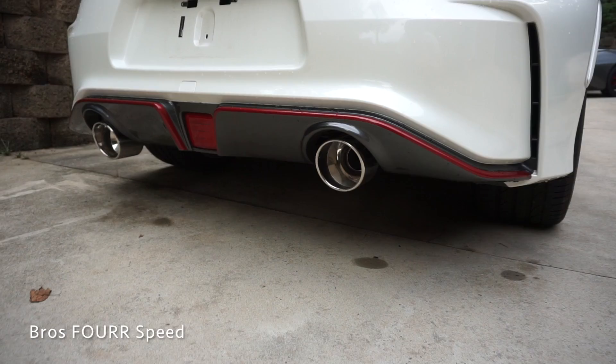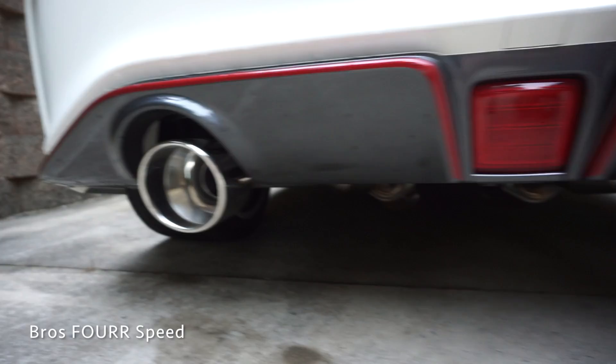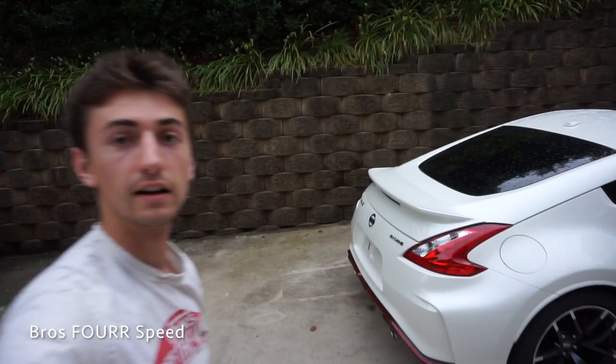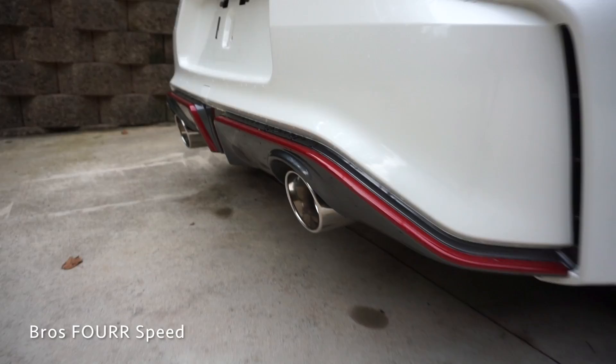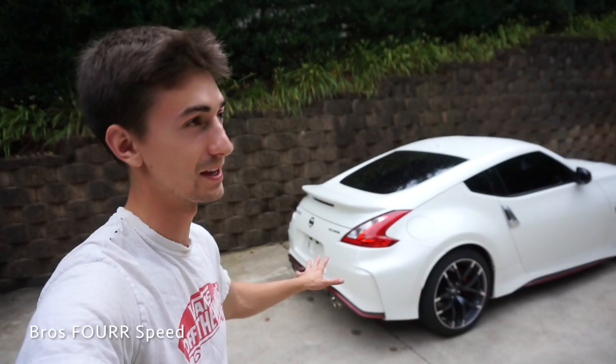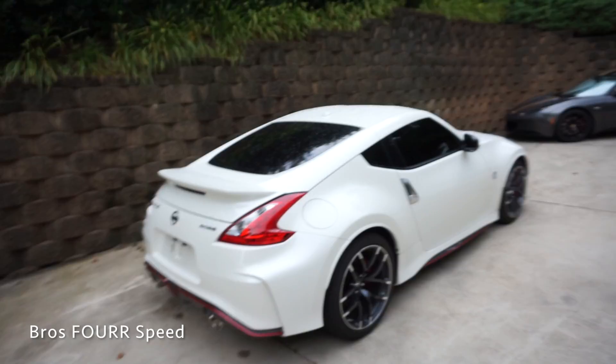Overall, as you saw, it's pretty straightforward — really had no issues during the entire installation. The overall fitment is pretty good. This side still hangs a little bit higher than the other, so I'm probably going to add a little more spacers to one side. Both tips are sticking out about the same amount — just about an inch. The sound is really good; I've been driving around for the day and put about 40 miles on the car. I'll be doing a full review comparing these to the non-resonated ones. I give this kit maybe 95 out of 100 for quality. Maybe one more spacer would be nice if the kit came with it, but I just reused the stock hardware and it works perfectly fine.